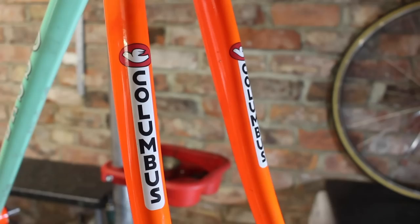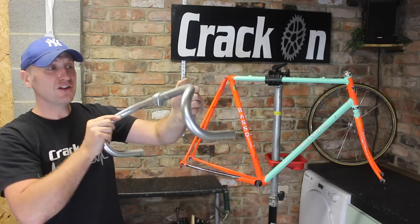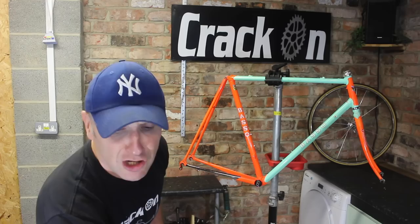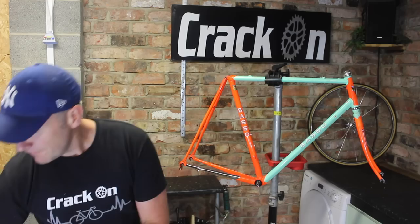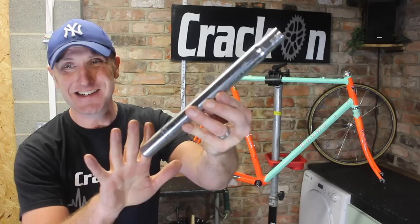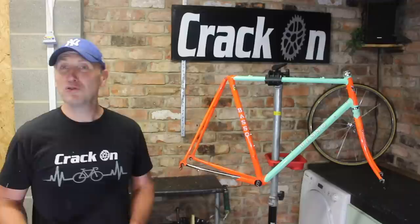I've changed the handlebars — we've gone with some Criterium handlebars, some Cinelli handlebars, with a bit more of a bend in them. I used to use these back in the day and they're more in keeping with the time period of this frame. Nice long stem on there. To go on the handlebars we are going to be keeping the levers, which incorporate the gear lever with Campagnolo, but I've bought some nice white hoods to go on these which will lift the white in the Basso. The seat post was a 25mm — the original was quite cheap — so we've gone with a nice fluted 25mm seat post, though it does need a little bit of polishing. So I'm going to get on with that and also wrap these handlebars.